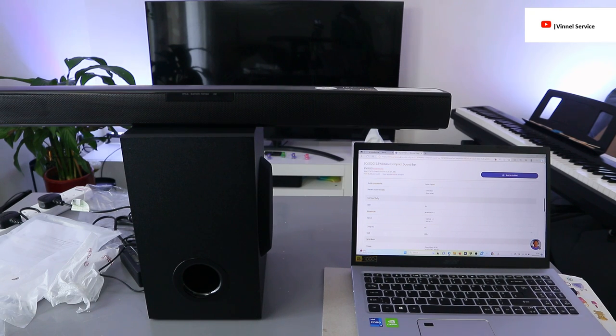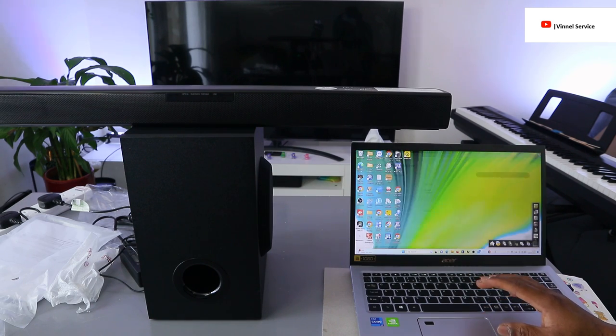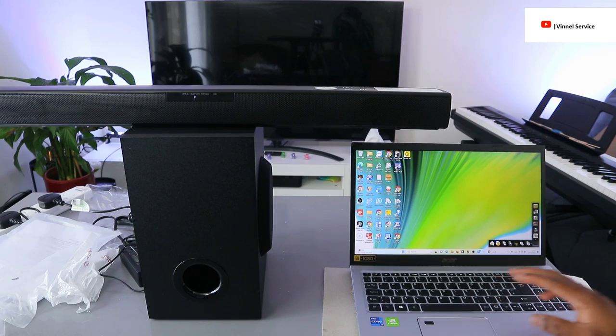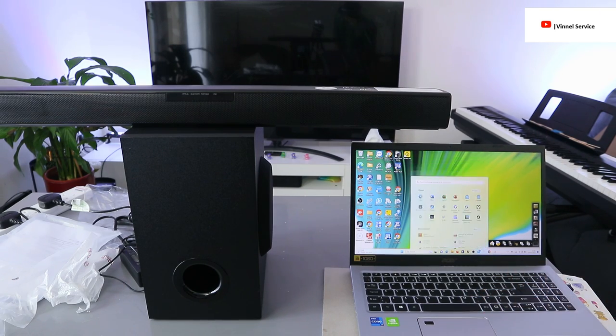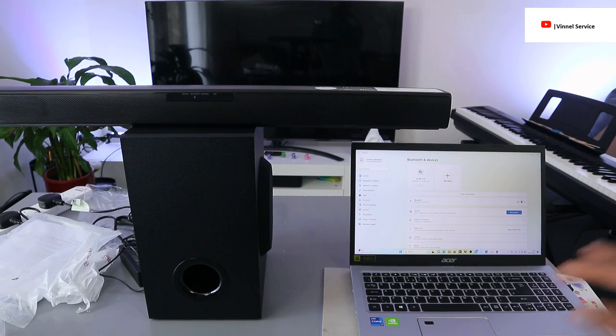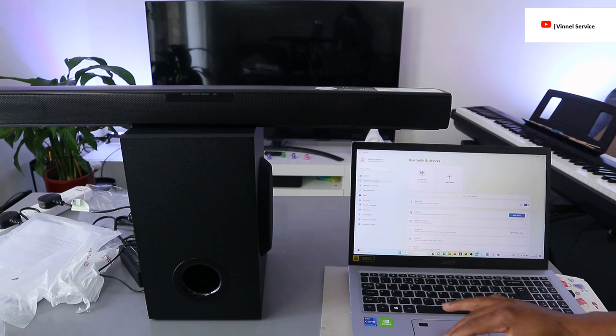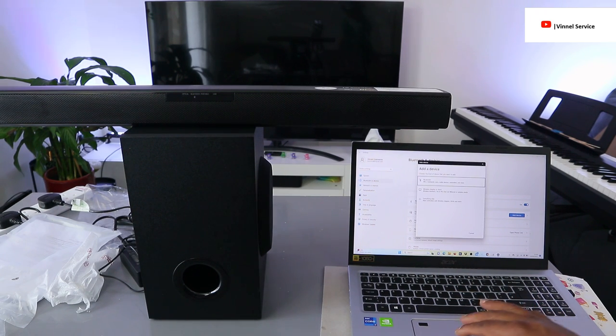So we'll go to our computer. Go to the computer settings. Now go to Bluetooth and devices. When you select Bluetooth and devices, you need to switch the Bluetooth on. The next thing to do is you need to search for available device. So you need to add a device. Once you add a device, then you need to scroll down and search for available device,